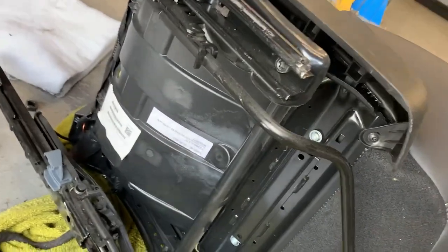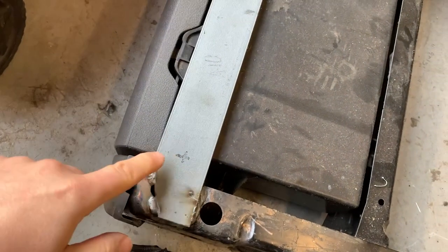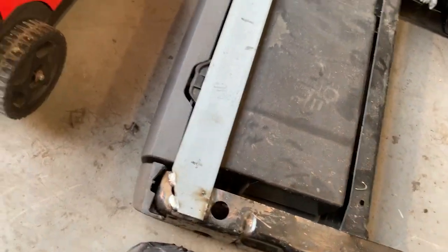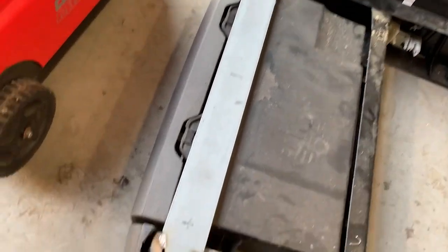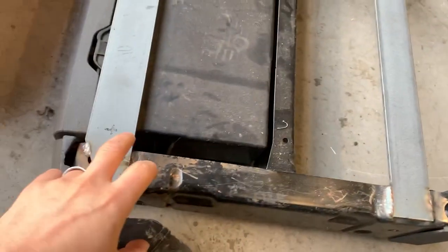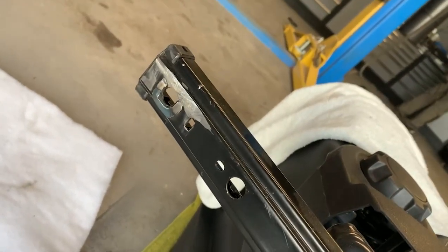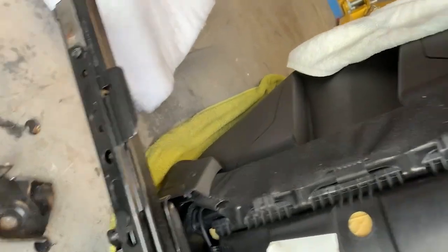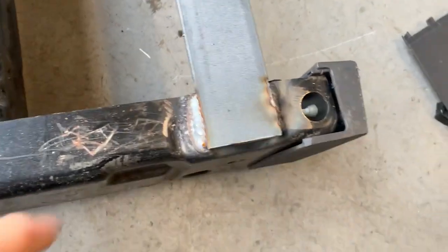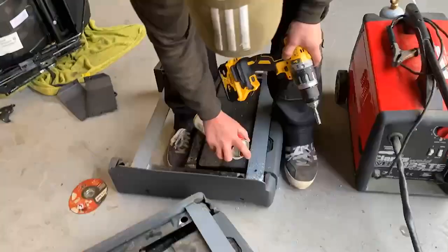What Craig is gonna do now — I've just measured the centres of these holes from there to there, and he's marked them there and there. I'm gonna drill them out and then tap them out so we can bolt the seats in. Once we've got the fronts in we can then mark the backs. I'm gonna have to re-drill one of these sides — drill it out, tap it out, and that should bolt straight in.